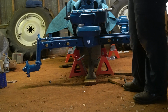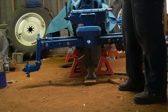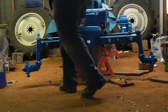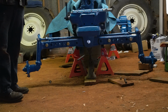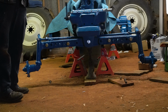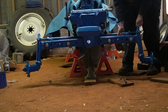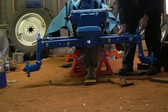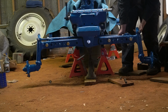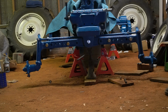And whenever you are adjusting this, try to do the same thing to each side. What I mean is, don't have one tie rod 30 inches long where the other one's 20. I'm just throwing numbers out there. So we'll come to this side and do the same thing. Try to get this joint about in that area. Okay, so now I have them fairly straight.